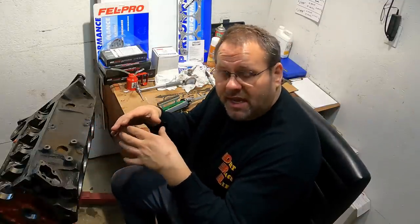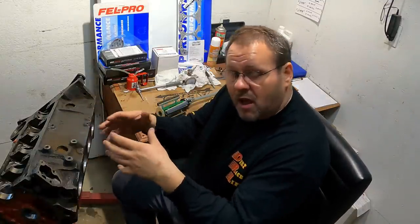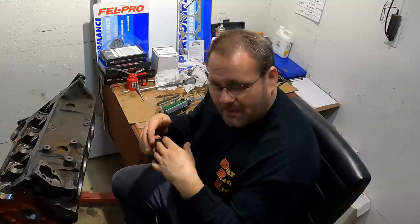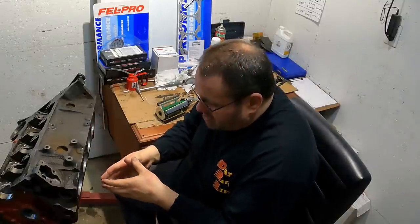But what I'm gonna be doing is opening that up. I'm not gonna be able to get all the taper out of it, but I'm gonna take some out. In other words, I'm gonna take more cut on the bottom of it to bring it up to what I've got on the top up here. I'm not wanting to take a lot of material off, so I'm just gonna bring it out until I'm breaking the glaze up in the top half, but then when I drop into the lower half, I should feel it load up on the drill.